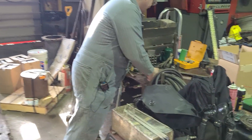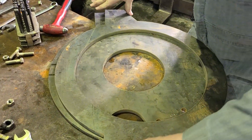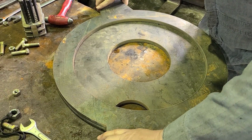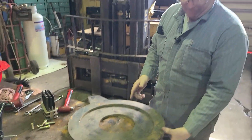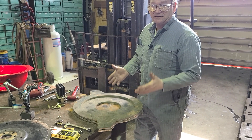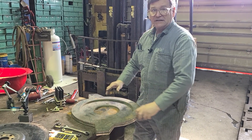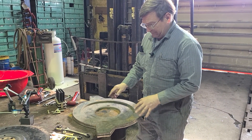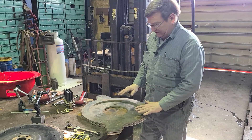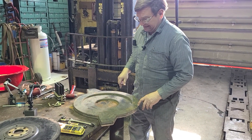This is the other side of the bell housing. When we weld these together, we will put the spacer in between them. Some of these are half-inch thick. We're looking for a five-inch overall size. We're facing the spacer to 50 thousandths extra, so that leaves us a little bit we can take off of each of these sides. After it's all welded together, we'll worry about the engine side first and then go parallel to that with the SAE side.